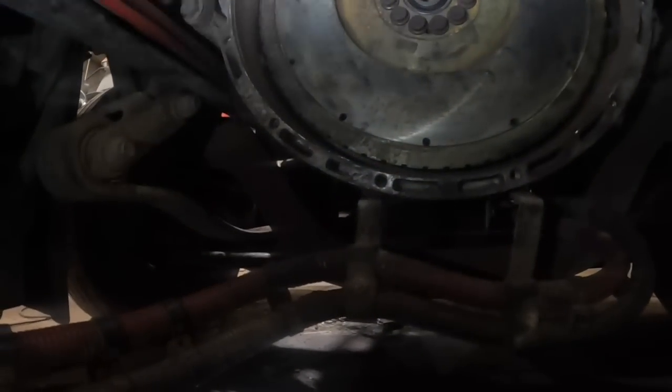And then my friend had a good point when I was talking to him about what I was doing. He said, why don't you just put one of them air-cooled ones on there? That'd be a lot easier. And, you know, I think that's actually what we're gonna do. I think back here somewhere, I'll just make a bracket or something and hang it. I mean, those things work just fine, and I think that'll be a lot simpler. We'll just take a couple number 8 hoses and run back to a cooler. You know, we'll try to mount it as close back here as we possibly can, and I think we got to mount it to where it's crossways. That way, the air's blowing through it, I would think, to where it cools correctly.